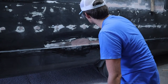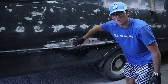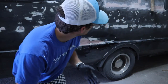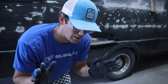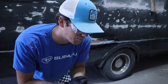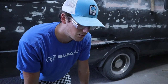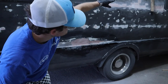So those are all done on one side. He's sanded this big area that I filled in with Bondo. I gotta put a little bit more here, which you're gonna see here shortly. A little bit more filler. Our patch panels are pretty much done. The adhesive on the one is still just, we've let it sit. We've taken it off to check a couple times and still just one part is popping out still. So we're leaving that for now. If anything, we'll do that tomorrow while we're taping or something, or maybe even tonight, who knows. But we left that for now, and so patch on this side.